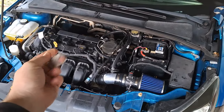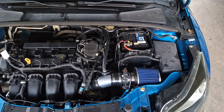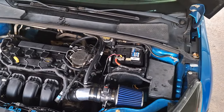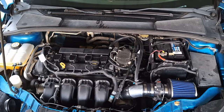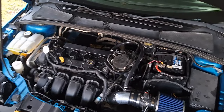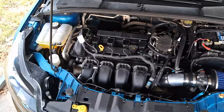If you have the one-liter three-cylinder engine, that'll come with a 6F15 automatic transmission — it's a conventional hydraulic automatic transmission. It has been rock-solid reliable. Just change the fluid every 30,000 miles, drain and fill it a couple times. The fluid does get a bit dirty, so keep up with the fluid changes and that transmission should last you a lifetime.